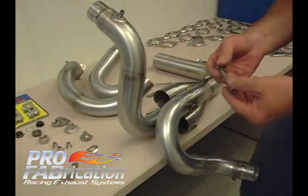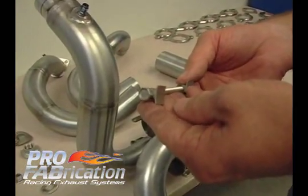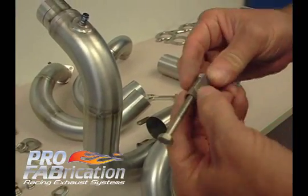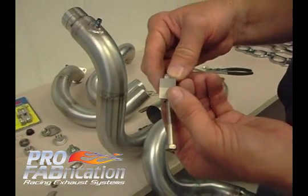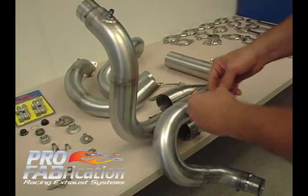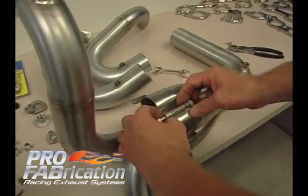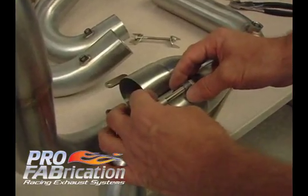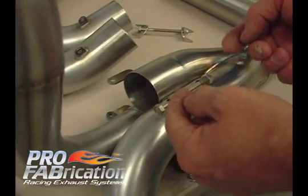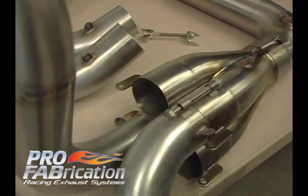The other connection we call these barrel tabs. These are machined parts — wire EDM parts — and they also utilize two different heights to make up the difference in wall thickness for this type of connection. We use a taller tab on one side and a shorter one on the other side. The same applies: we don't want these too tight in service on the race car, because it will start to tear that material out.